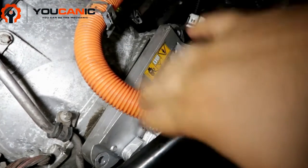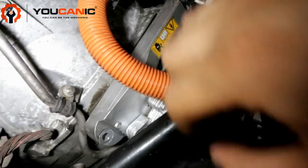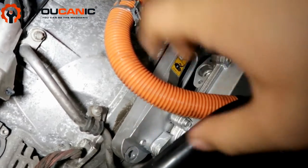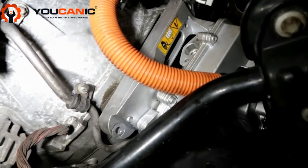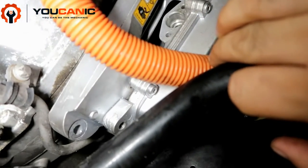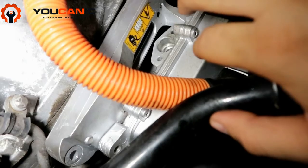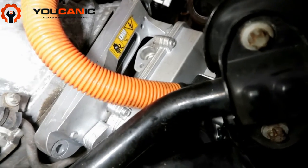This cable can also be disconnected — it connects to the AC compressor on the other side of the engine and to the high voltage battery. You can disconnect it right here through a small access door. Pull this out and you have access to it — it has two 10mm nuts that allow you to disconnect the cable and pull it straight out. There's a clip holding it in place, so you must remove that clip first. One thing to keep in mind: the wires are red and black, but when they connect to the power electronic module they're reversed — black on positive and red on negative. That's how it's designed, and you can't mix them up anyway because one cable is longer and one is shorter.